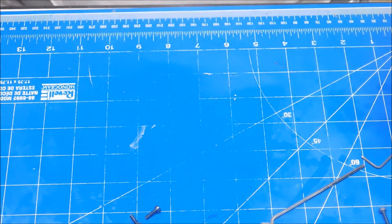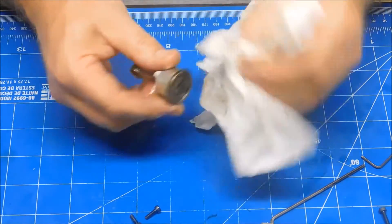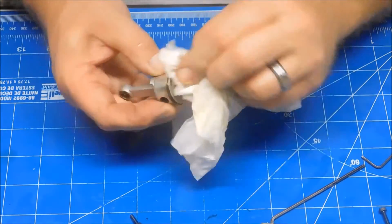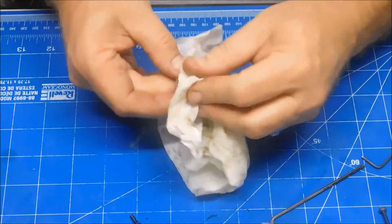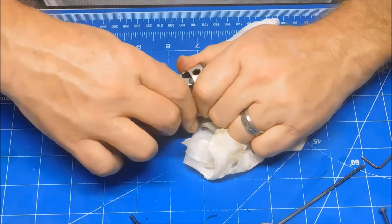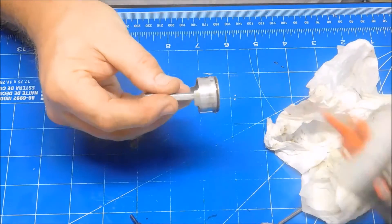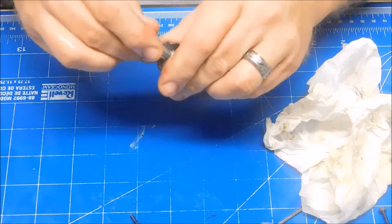Now let's take a look at this piston here real quick — let's pull this thing out. That thing's still really stuck there. I'm gonna really have to oil that up. I'm gonna heat this up some more and get this ring freed up. Working it, but we'll get some oil on it. I'll apply some real heat to this thing. The LA's Totally Awesome Cleaner — it looks like it cleaned up the sides of the piston a little bit. I'll have to get a toothbrush onto the top.